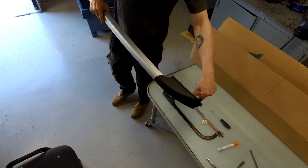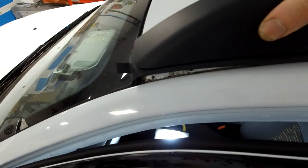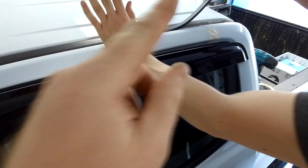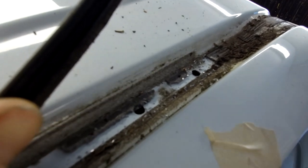Flat side towards the front. Offer it up — front two bolts first. It's half in at the front, half in at the back. One hole needs to go back a couple of millimetres. Either the front one needs to go back or the back one needs to go forward. We'll just file those out slightly to centralise them — don't file too deep.